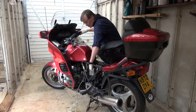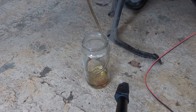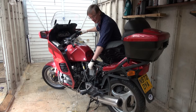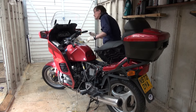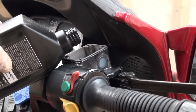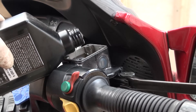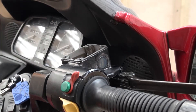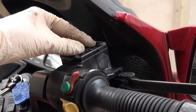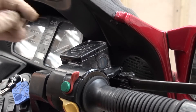The procedure is: open the valve, pull in the hand brake, close the valve, release the hand brake. My fluid's getting a little bit low now so I'm going to top it up. That's enough — put the lid back on again because I don't want fluid spurting out while I'm doing this.